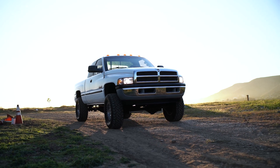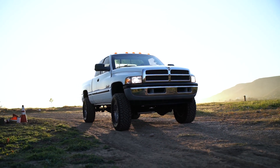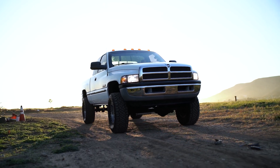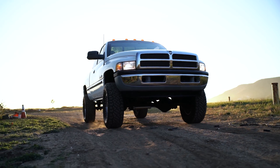The second thing is tire wear. If you have your tires overinflated, you're going to wear the center of the tire and not the edges because it's going to be ballooned out. You're wearing through your tires prematurely. If you spent a lot of money on tires, you want to get the full life out of them. So we're going to figure out exactly what this tire should be run at.